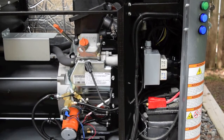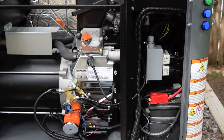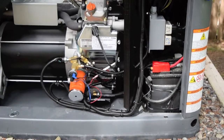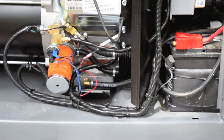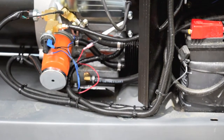I'm finished installing the second 50-watt block heater. I've got it siliconed in with a high-temperature silicone, got split loom on the cord, and everything's tied up right down in there.